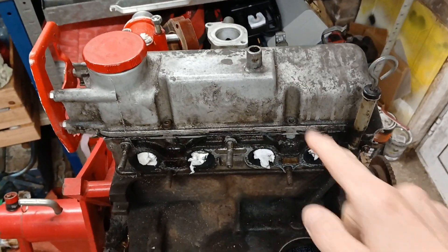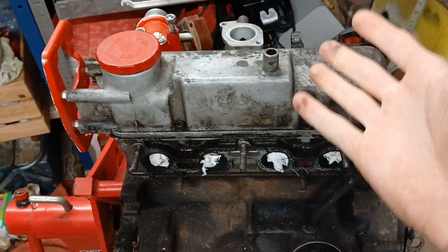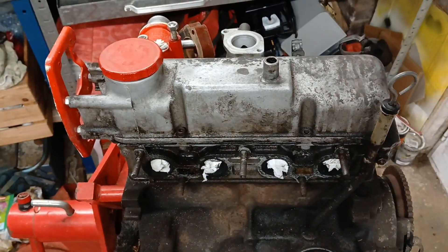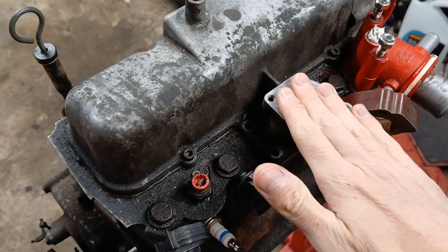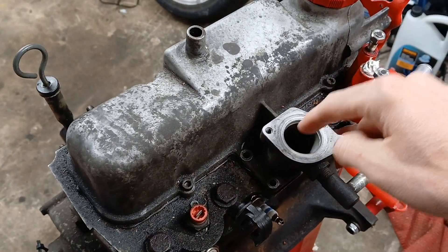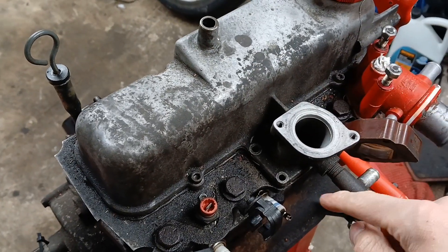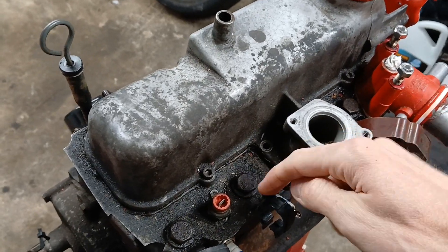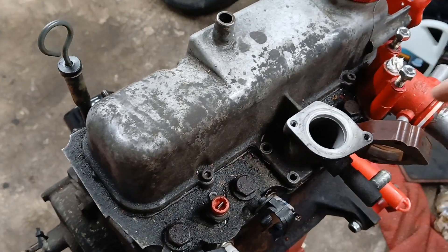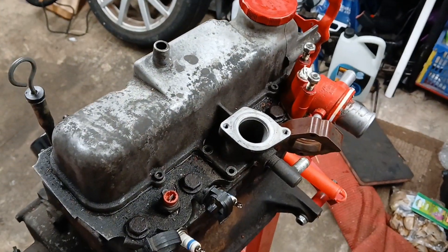These are all Allen key bolts on the normal sporting one — it's only just a few bolts running outside, but on one of these you've also got four around here as well. For any of you who don't know these engines very well, this is the inlet. The inlet is actually part of the rocker — it goes through here. When I take this off, you'll see what I mean. The actual inlet is just one hole right on the side of the block, and then the inlet splits off into each one of the cylinders.